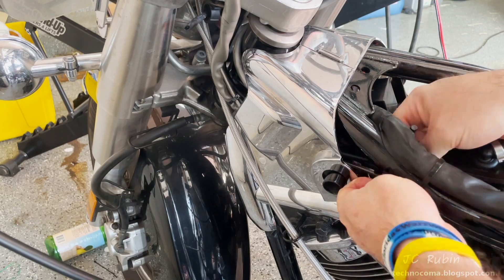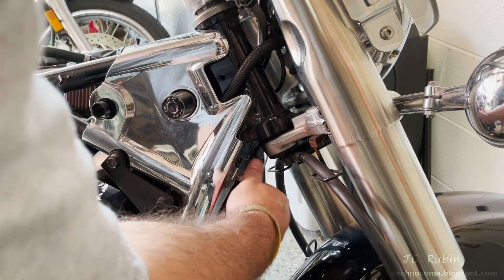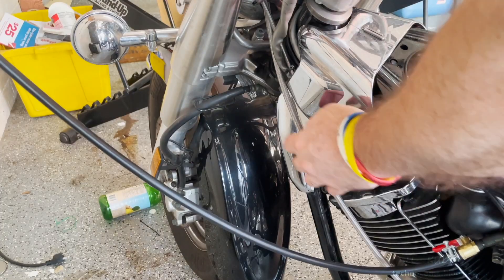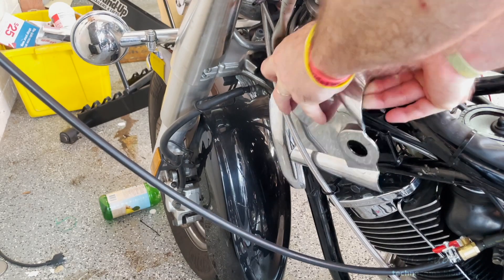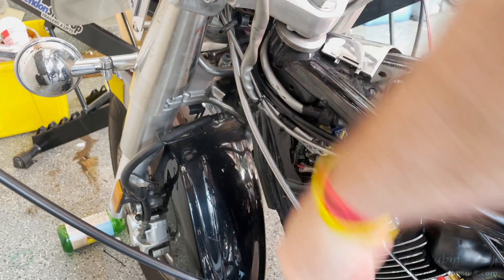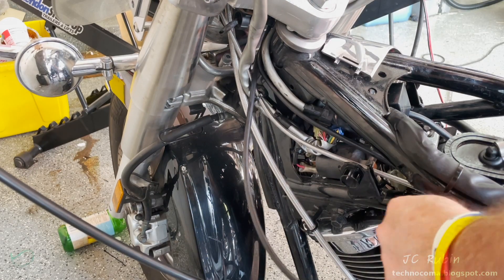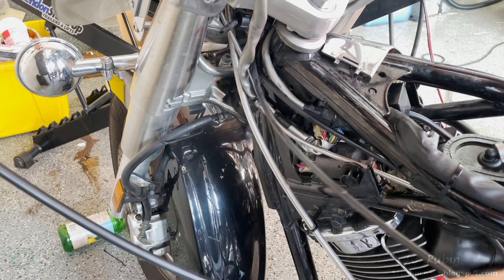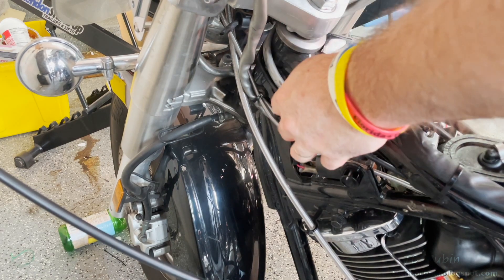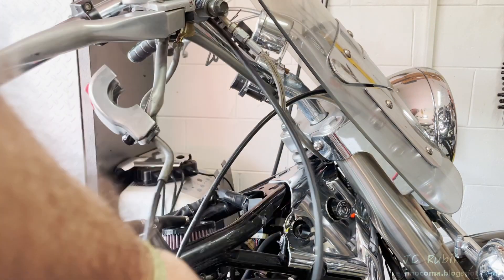There are two cable looms behind here that I remove, and three cable holders. The screws up front also secure this trim — I've since replaced the original screws with hex, as I do for a lot of screws on this bike. I remove the cover on the low side. I had a cable tie holding everything together. Now I'm able to pull the cable through, though it does get caught on things. I pull it back through from the other side through the triple tree, and it's out.